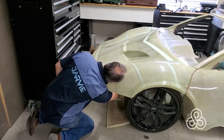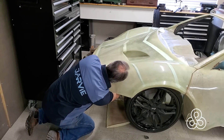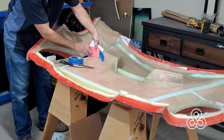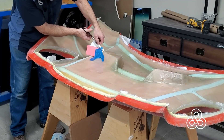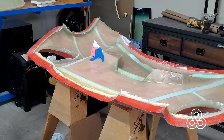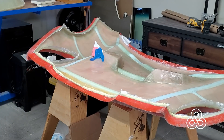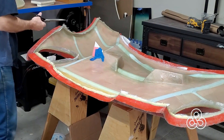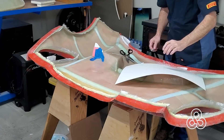To finish off this video, we're going to go back in and try it in place once again. I didn't have time to go further in this lamination, but what we're doing now is putting in some little template pieces I need to build an air dam to force air coming through the radiator to go through these little vent holes - these little nose holes that will be cut out. I took a 3x5 card and placed it in while reaching underneath the car. After trimming it, it looks like I've got about another inch to go. Once I trim it there, it fits right up against the aluminum sheet metal of that crash structure we built in a previous episode.